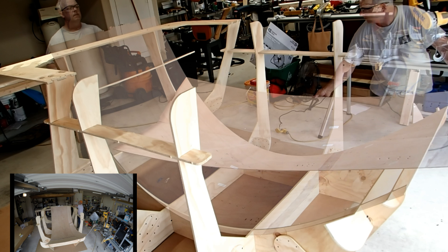Some important things to remember about wire stitches, especially copper wire stitches as opposed to steel ones. One: the more you flex it, the more likely it is to break. Two: the more you stretch it, the more likely it is to break. Tightening a stitch to pull two panels together can break the stitch. You're better off trying to push the panels together and support them while you tighten the stitch.